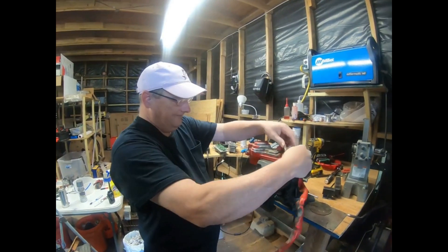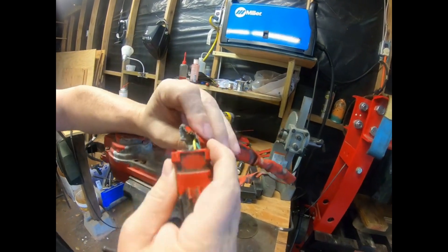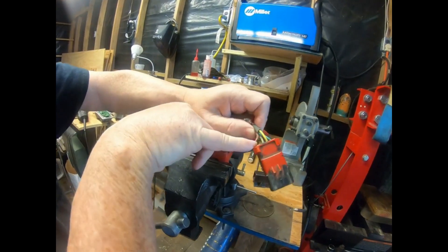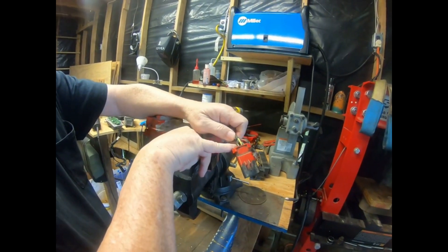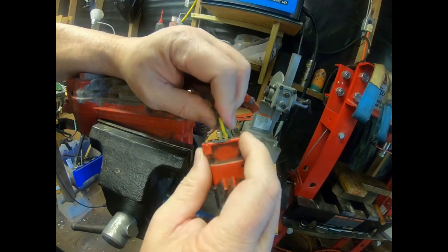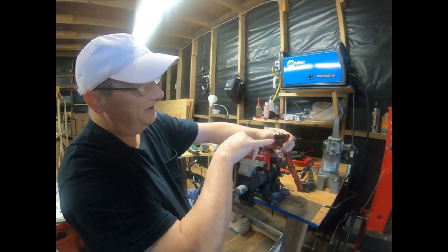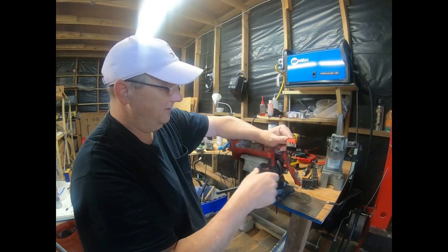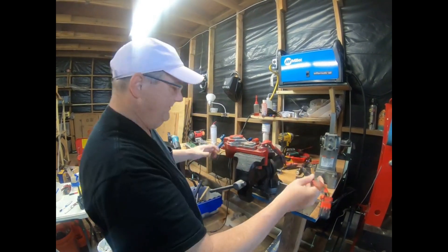The first thing I notice looking at the wiring: the harness is quite worn, but the wiring seems okay except for right here — there's definitely a broken wire. If memory serves me right, that's the plus 12-volt power connection. The second wire would be the ground, zero volts. Then these two wires on the far right according to the plug would be CAN bus plus and minus. So we definitely need to fix the wiring. I do have pins for these plugs — they come apart, though not easily — so maybe we'll make a little video on replacing that pin and re-soldering that wire.